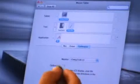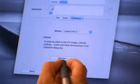Once the driver has finished installing, the pen should map to the Cintiq display, meaning when you get the pen close, it should control the cursor under the pen. Now the cursor may not be exactly where you want it, or it even could be moving on the other display at first, and that's not abnormal. If that's the case though, you will want to calibrate it. Watch the video about calibrating your Cintiq display, and if you're using your Cintiq with another monitor, watch the videos on dual display configuration too.